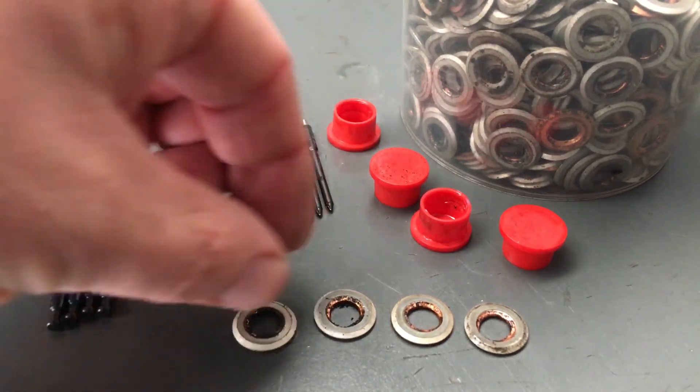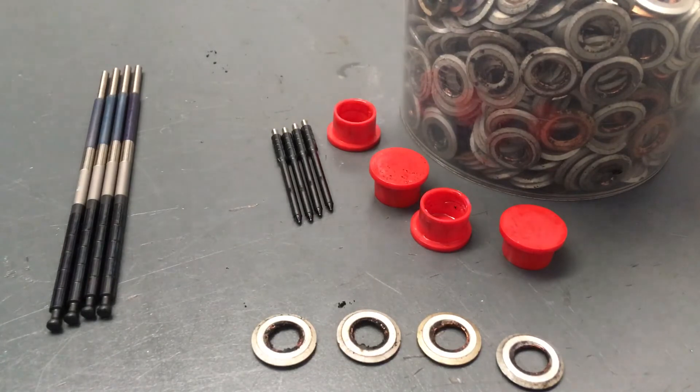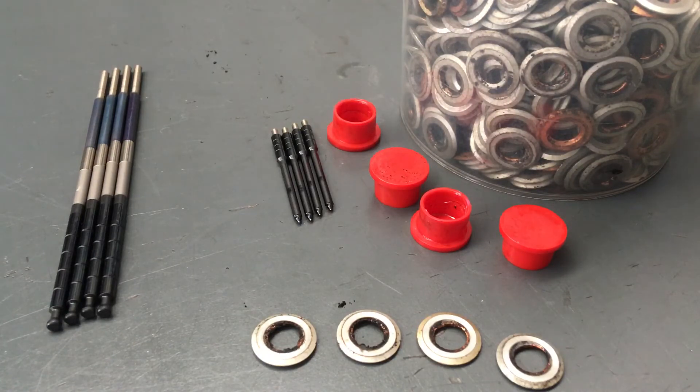The seats are starting to erode away in the middle but they're still holding quite well. Let's turn them over and see the other side — the other side always looks different. They're very clean on the back, which tells me they've probably never been out before. The seating area was really good, so these weren't about to start leaking soon. At 177k they're holding well — the vehicle looks like it hadn't been worked on.